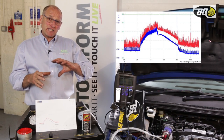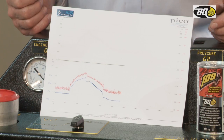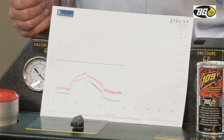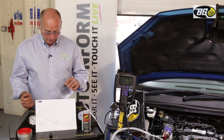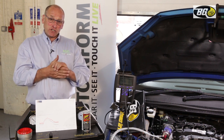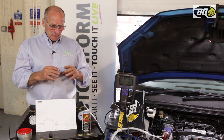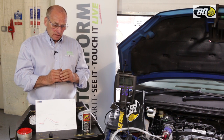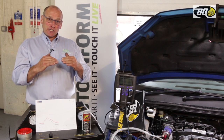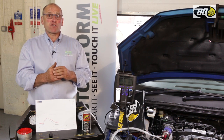That proved that with an increase in volume and engine speed, the pressure buildup was excessive — the wrong characteristics indicating a blocked DPF. Having gone through the loading stage at low speed with product saturating the DPF, we then turned the product off, increased engine speed, and drove the temperature up to around 700°C.